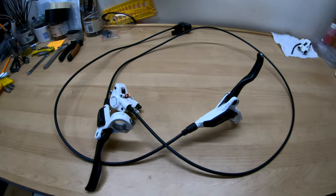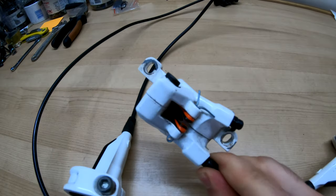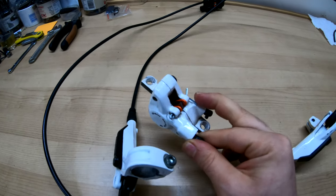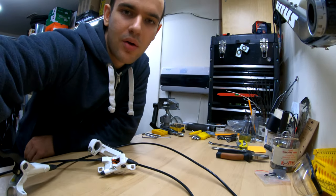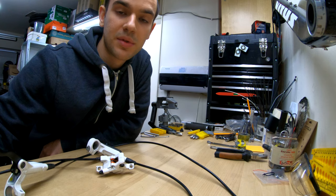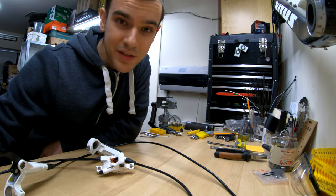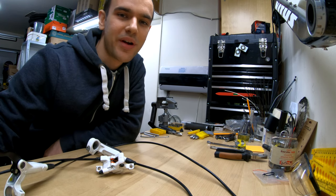And the brakes are done — it went very smooth which I'm very happy about. These pins are a bit too long but hopefully they won't be annoying while riding. Here are the new pads. I also cleaned up the wheels and cleaned the discs with isopropyl alcohol, and everything is ready to be put back together on the bike. I'm very excited and can't wait to show you the end result.